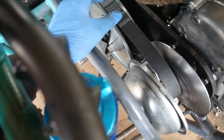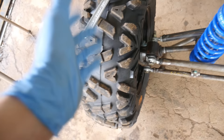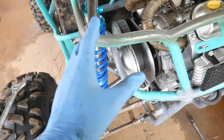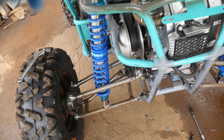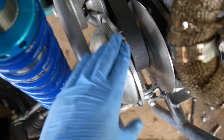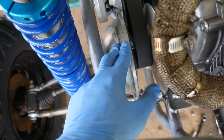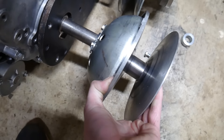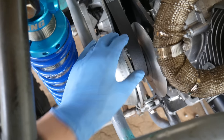GoPowerSport sells these pulleys as a direct bolt-on part for convenience, so it's not their fault at all. I'm just running a crazy power level with these huge tires, so I need to get the most out of the CVT. If we get this issue fixed we could possibly see a lot more power to the ground at higher RPMs. One of my subscribers came up with a clever idea: instead of flipping the driven pulley around, flip the drive pulley around — and I thought that was a great idea.